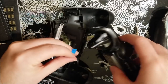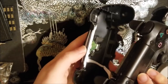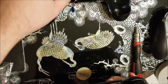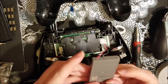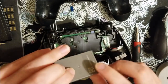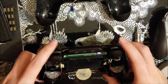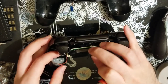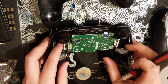If I plug this in, you should be able to see — yeah, there you go. That's exactly how the light bar works. Next, removing the battery. This battery is 1000 milliamp hours at 3.7 volts. It's actually rather light despite being pretty large — feels kind of hollow almost, so the casing is mostly for protection. There's one screw here, and the board starts to lift out. Wiggle wiggle — there we go. The battery holder is gone; that's just the board.